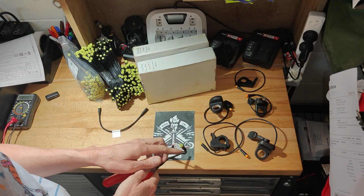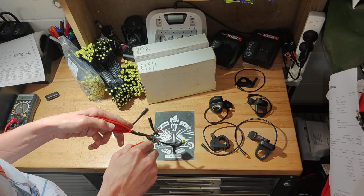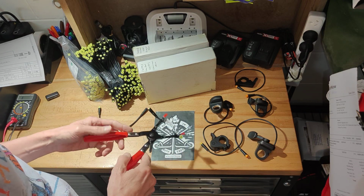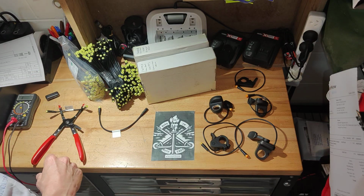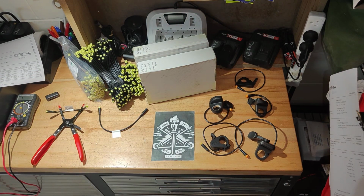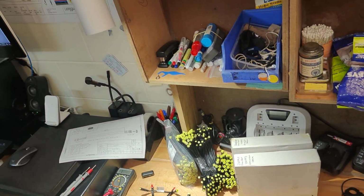And on the other end, there's a plug that will go into the harness and go into your stem for scooters that are either, say, a NAMI or Kaabo make. So that's just a straight swap of the pins of the two that are not black, basically, in the cable.